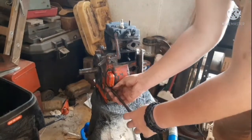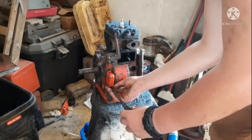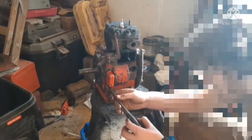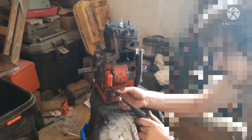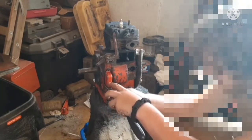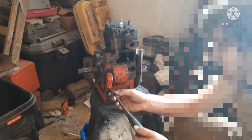Okay. If you're curious, here's a little fact. If you're curious why this had a button, I found out what the stuff on the back of the engine was. It's actually a kind of coil system, but mine apparently went out with the guy who owned it last, and they replaced it with a normal coil system. So that means this engine originally could be pull started and ran without a battery, which is kind of what this button's for, to shut it off if it doesn't have a battery. Clearly your key doesn't work and whatnot, so that button just helps shut it off.